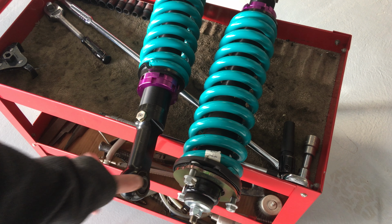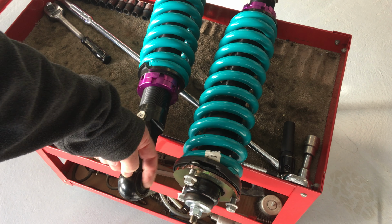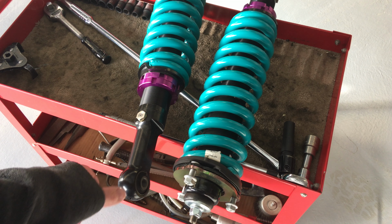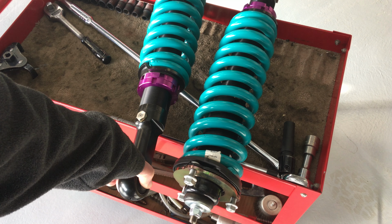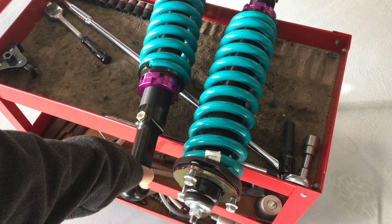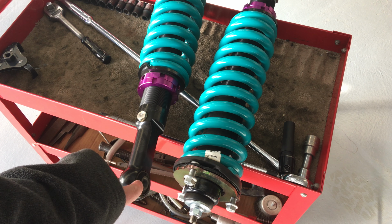If it was loose, then you'd get knocking noises because this actually can move a little bit on the bolt and sort of go knock, knock as you're going over bumps and stuff like that. So that's tight, neutral. That way when the suspension goes up or down, right, it can go either way. And look, these bushes don't get damaged from that.